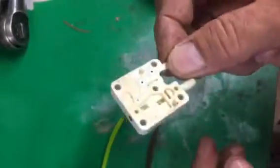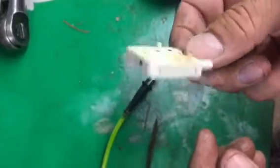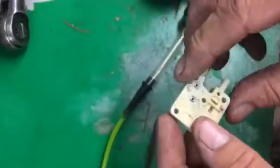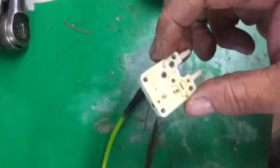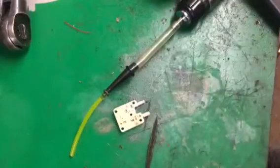So we know both check valves are working — they're letting air pass through in that direction and not letting anything come back the other direction. Both check valves are working, this primer base assembly is good. So any problems I have with this carburetor, I know aren't in this piece. This piece is $15 to $20 online depending where you buy it, so it's good to be able to test it. Anyway, that's how to test the primer base assembly on an Echo weed eater — thanks for watching.